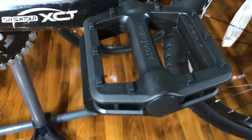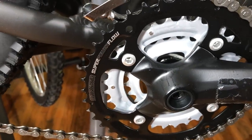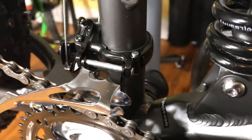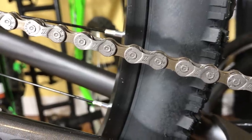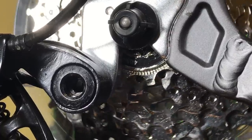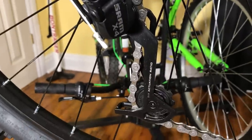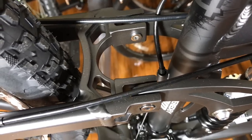I was expecting alloy pedals, but instead we get polymer Mongoose branded flat pedals paired with SR Suntour XCT branded crank arms and an SR Suntour Super Power Flow crank set. There's no information on the actual gearing, but it does look decent. The front derailleur is generic but considerably better made than other Pacific Cycle generic front derailleurs I've seen. A KMC Z72 chain meets up with an 8-speed 11-32 tooth cog set — I've never heard of G Falcon and couldn't find any information on them. Here's the SRAM X4 rear derailleur, with basic Mongoose branding on the chainstay.